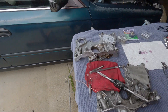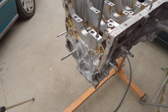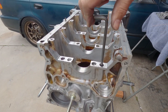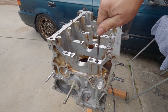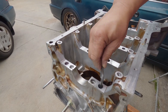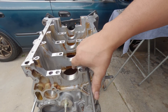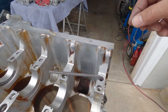There are a lot of ways of doing this, so if you can come up with something different — whatever makes you feel comfortable — but make sure that you plug the right one. I can't say much about the H22 because I have not done it — not on the H series, only on this block, the F23. But the idea is the same: you are trying to plug the oil supply to the balance shaft.